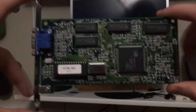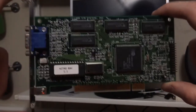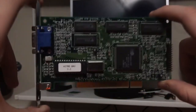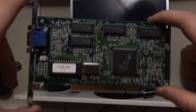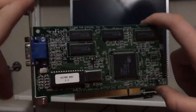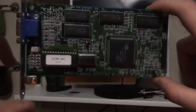And the other piece of hardware is this very old Cirrus Logic 2D accelerator card, which is used for, well, 2D acceleration. So this has 3.1 drivers, and since the old Windows 98 machine's built-in Intel GMA certainly doesn't have drivers for Windows 3.1, we're going to be sticking this guy in there and using this instead. It won't be fantastic, but given our limited part availability, this is the best we can do.